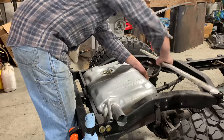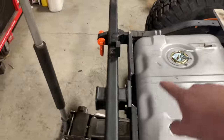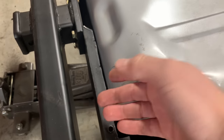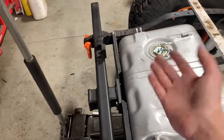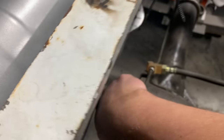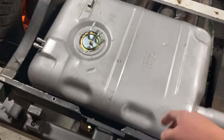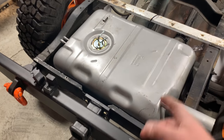Let's go ahead and see what we got. Alright, so I got it back in here with all this cut out. I've actually decided I'm going to put it under the rear crossmember now, because this is going to be a solid piece — there's not going to be a lip on the inside to set in — and I still want to be able to remove this from under the Jeep. Over here though, we've got a bunch of room now and I think everything's going to be fine. Now that I know this is going to work, I'll go ahead and pull the tank back out, cut this rear crossmember out — of course I'll have to pull the bumper off. Alright, let's do it.